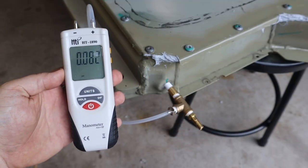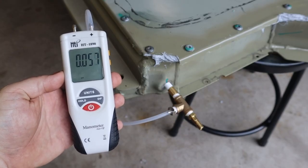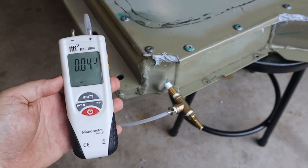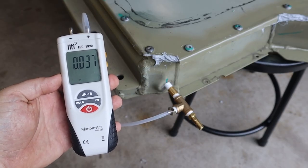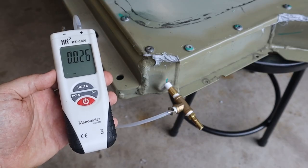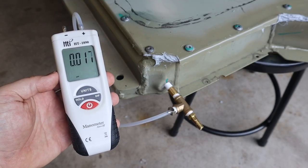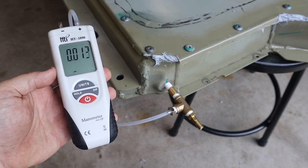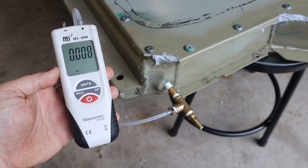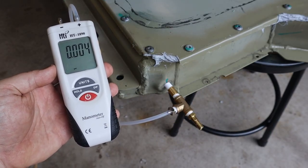This battery has failed the pressure test, so now I've got to figure out where that's coming from. That'll be a visual inspection — maybe a spray bottle of soapy water — but we see that number going down, and that means rainwater could possibly get in the pack, and we can't have that. I just caulked this up last night, and who knows? Maybe I didn't use enough caulk. I'd be a lot happier if it was just replacing an umbrella valve, so I'm going to check those first.